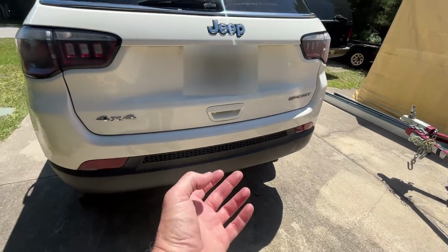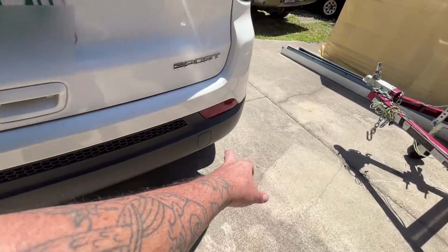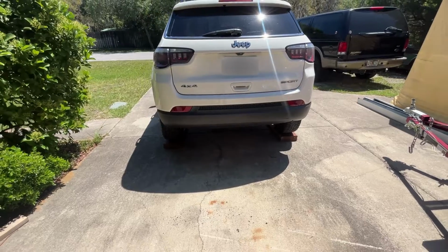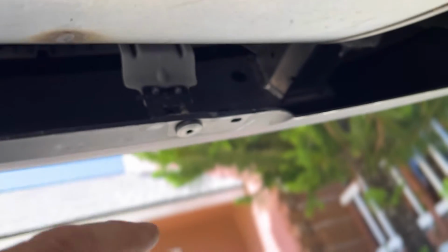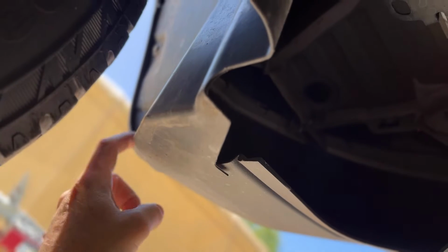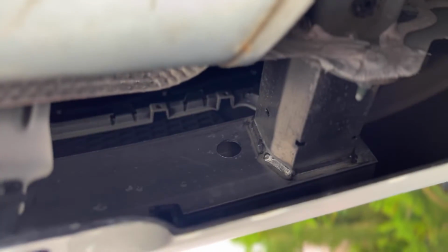It looks like there's only about 3 bolts underneath somewhere, and then there should be around 5 clips on each side, and 8 clips across this front edge to pull the whole thing down. So let me get underneath and I'll see if I can show you where the bolts are. All right, here's the view from the underside. You can see the muffler is right here. There's the rear fascia. You have a T30 Torx right here. There's also one right here. The other 2 are what would hold on your mud flaps if you have mud flaps, but they're just holding the fascia to the inner wheel liner. And you have 2 8mm regular bolts up here. I'm gonna start by doing that. So let me get the hardware loose and start unclipping the tabs.